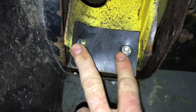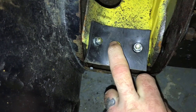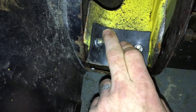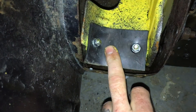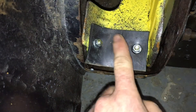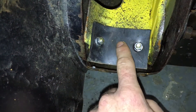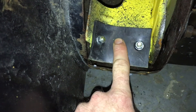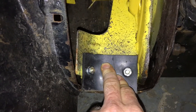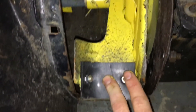I got my paddle bolted in with a little bit of blue Loctite. There's always a debate between nylon lock nuts and blue Loctite — I prefer blue Loctite because you can take it off and put more on; nylon lock nuts are really single-use only. Going with blue Loctite on regular stainless steel fasteners — again metric 10 millimeter, they're everywhere. I'm definitely going to put a third bolt through it. If you have a four-paddle impeller, you may want to experiment with doing every other blade, since doing all four can bog down the engine and cause clogging. I have a three-blade impeller so there's no question.